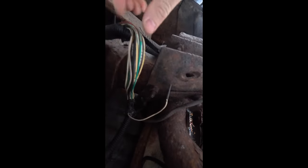I cut all that out and still no lights. You start back-probing and then start following it up. Then you find stuff like this — you're like, man, someone else has been in here. As soon as you find electrical tape, that's a good spot to start digging. Finding this yellow one where someone's been in there — nothing was broken there. Then I found some electrical tape, investigated, and found nothing. Then going back in I found duct tape, and I'm thinking, how far am I going to have to follow this? All the way to the front?